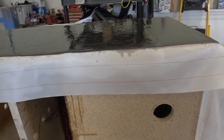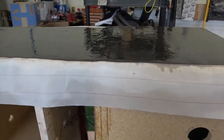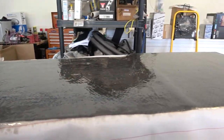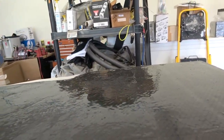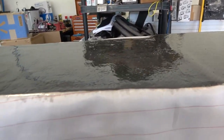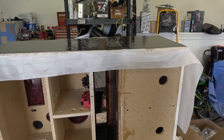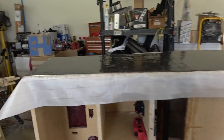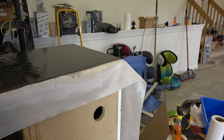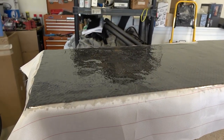So instead of working at sanding constantly, which you know, maybe some people are okay with, this is just dabbing this on. And personally, I think this takes less work than all of the sanding. All the sanding and everything, I think, takes more time. But it's just another way of doing things, and in my opinion, this is the better way to do it, because like I said, it ensures a nice flat surface of your carbon for applying your top coats.